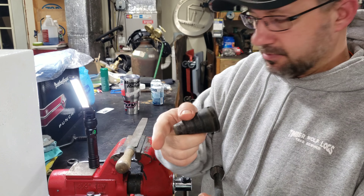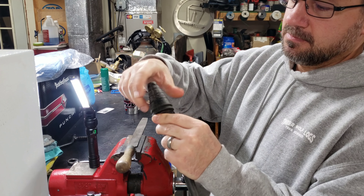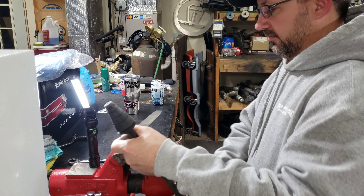One other thing we could do — put a little bit of Bel-Ray waterproof grease on here. You know what, no — I'm going to leave it dry as it is and just see what happens the next time I go to use this thing. We'll go ahead and put this right back on, take our file out of the vice, put our wand back in, take our 18mm and tighten it up as much as we dare — that should be plenty. My suspicions are that we've done a repair on this. I'll have to let you know later to see if we fixed it.